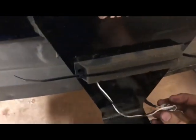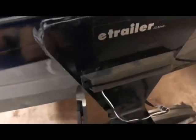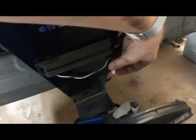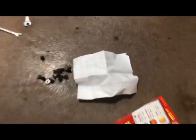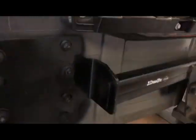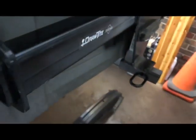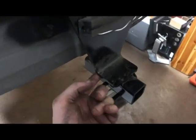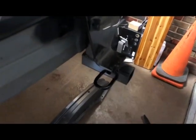They want you to use zip ties, which they kindly provided — that seems a little sketchy, but whatever, we'll use the zip ties. I'm actually going to grab a third one and wire this up just a bit so I don't accidentally hit it with trailer chains someday. It did come with a one-to-one pattern, so I'm going to try that. I'm doing every other hole for washers — you can do whatever you want. Other than cutting out the bumper and putting it back on, we are done. This thing is just bananas how overbuilt it is for a class one.